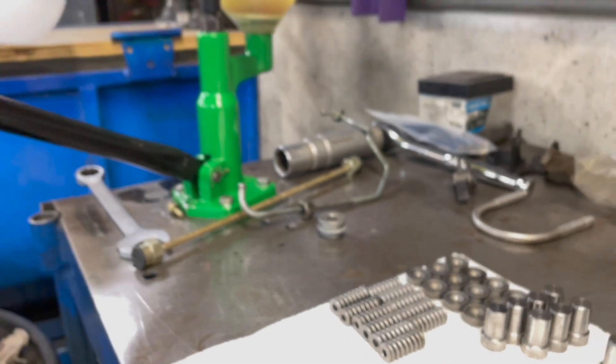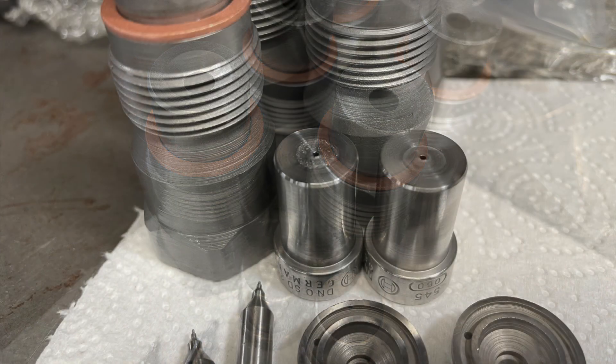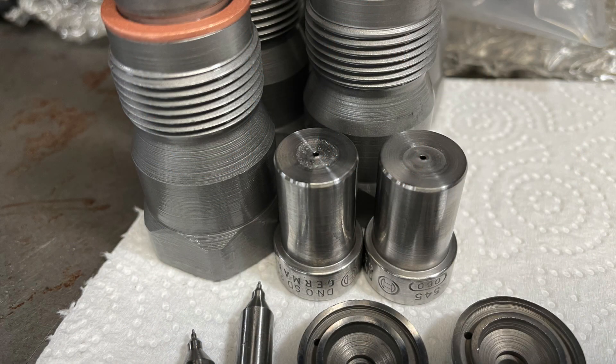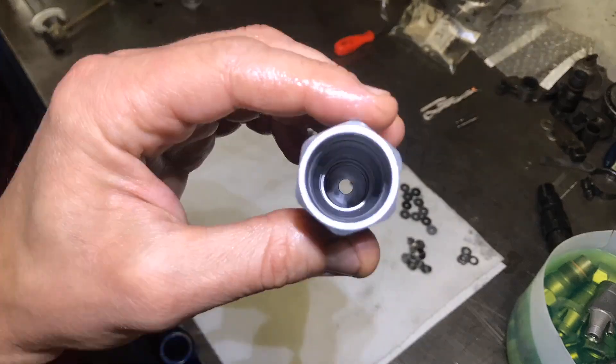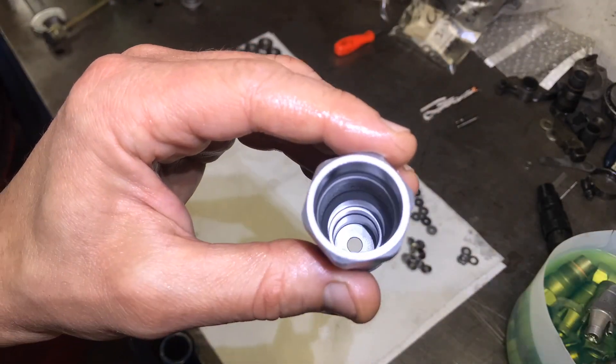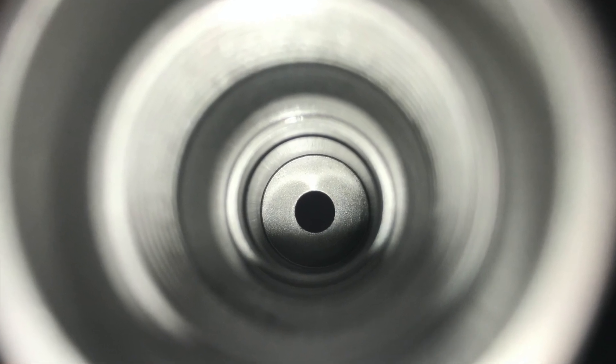Everything's cleaned up — it's time to play judge, jury, and executioner. Look at all that cavitation; that nozzle is completely eaten up. And on the inside of the bodies there's even more cavitation — it just makes me sick. The question is: am I going to be able to get enough good parts to build six injectors that'll hold 150 bar and get a good spray pattern? Let's find out.